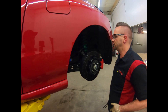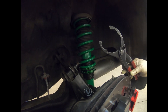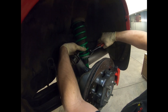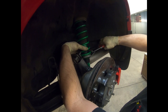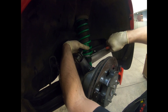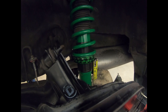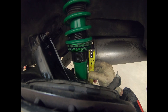I just want to show you how we're going to adjust this thing. I really don't like the keys that they come with — my trusty oil filter pliers work much better. So as you can see, you take the coilover and just turn that bottom puck to get that ride height down. We're going to do it about a quarter of an inch — in the front we were at an inch and a half, going to an inch and a quarter — so a good couple of turns. Let's check and see where we're at. That bottom ring is at an inch and a quarter, need to go a couple more turns.